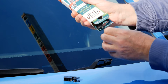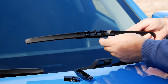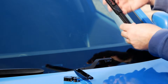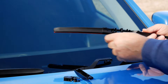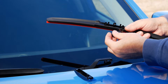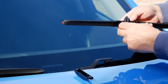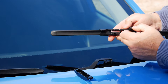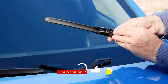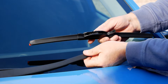Open up the box and get the new wiper out. When mounting these, it has a lip at the top of the spoiler and you want that to be at the top of the wiper arm — you don't want to mount them the other way. Copy what the originals are like. Get the little hook adapter and make sure you snap it in the right position — the arm is coming from this way and hooking around. Snap that into the centre piece, then put the cover on over the top, lift it up first, snap that down, and now it's ready to put on the hook.